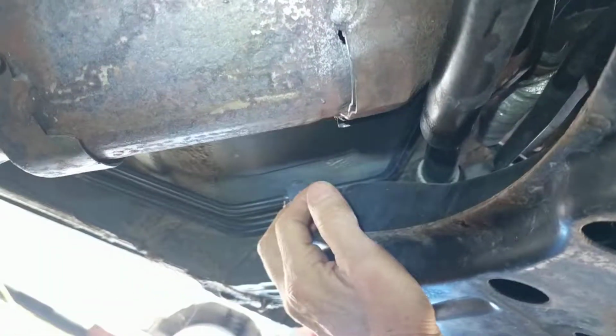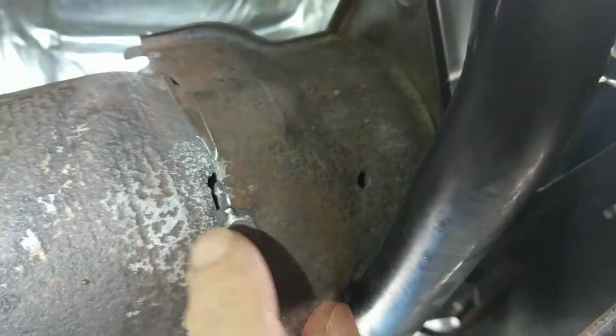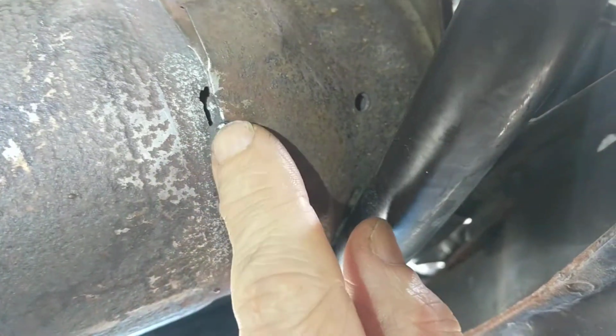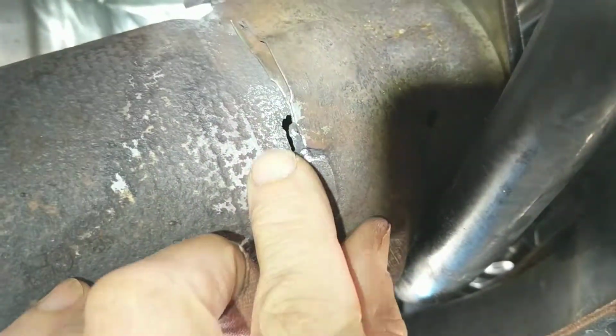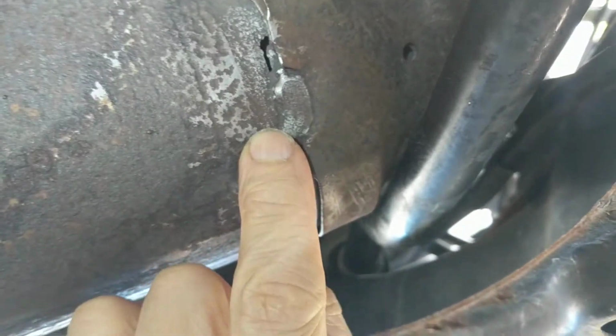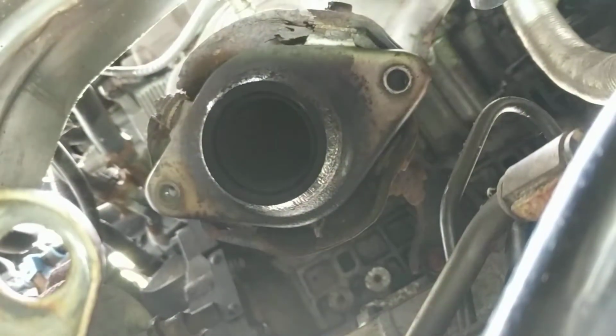Okay. Now, it's a very expensive pipe, and I've just prepared this for a patch. I sanded it, I wire brushed it, I put on some hydrochloric acid just to clean it up because it dissolves rust. Then I just washed it off, and now it's all dried out. It's ready to go. It fits into the exhaust manifold right there.